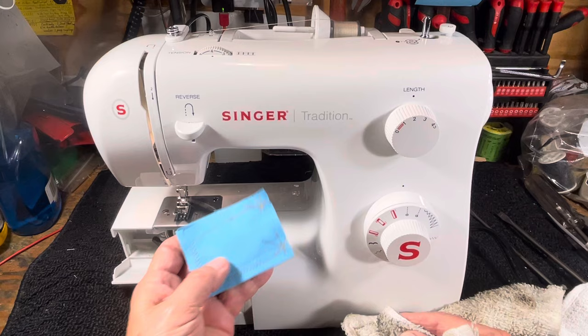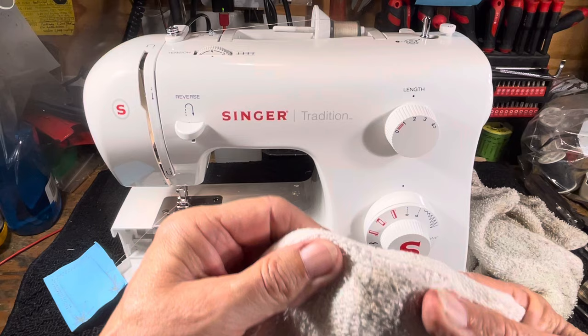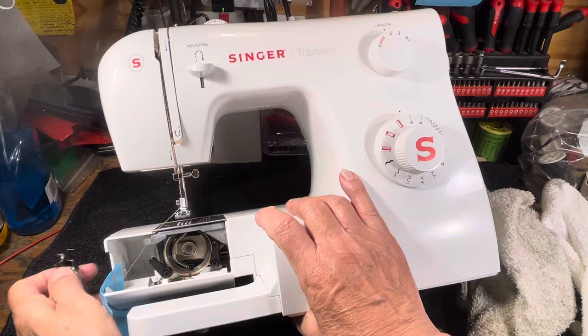And then I will keep going to clean rags until we get down to the very last clean out. And it's like this. And then we oil it again and wipe it out till it's absolutely clean. There's nothing coming out. And then we put another layer of oil in there. So this runs on a layer of oil between the actual hook assembly, which, like I say, is hard chrome, and over here on the right-hand side where it goes in.